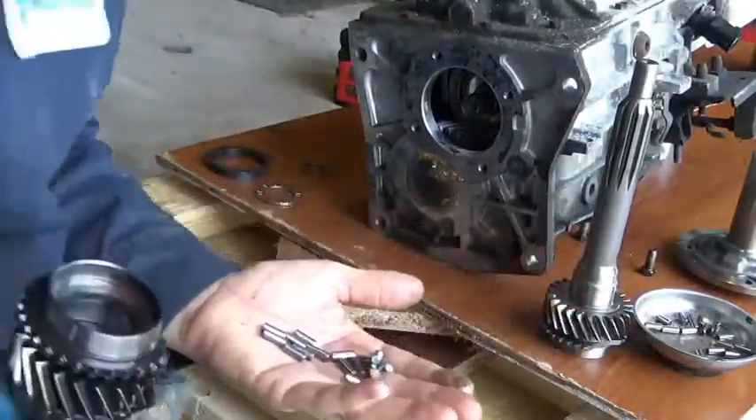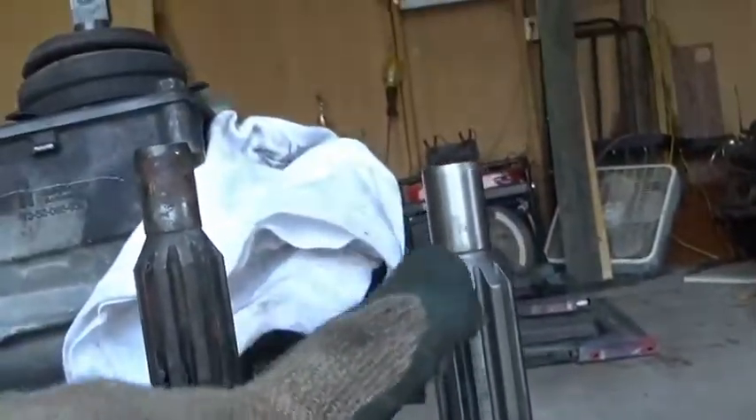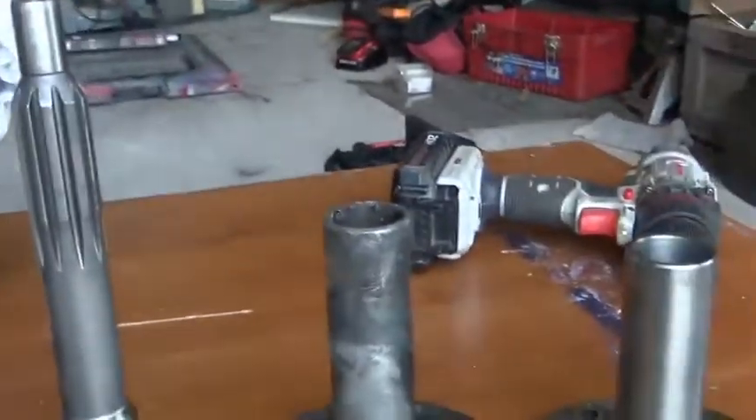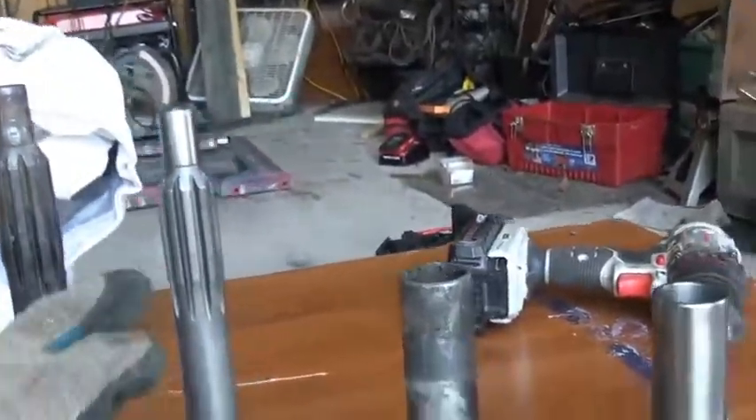They sent 16 with a new one — I guess they planned on me losing one. There's your difference — see the difference in the height. If you think you got that much room on the driveshaft, you don't have to change all this. You don't have to go find a bell housing. I've got a bell housing under the car, and there's the input shaft. You don't have to change this out if you go that route. But if you want the shifter in the correct place, you're going to have to get the shorter shaft and the shorter bell housing.